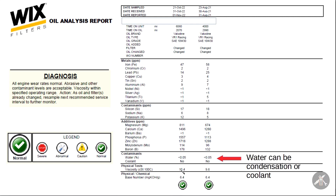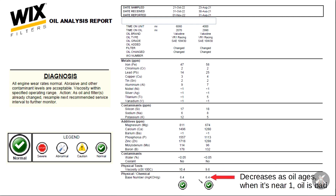Viscosity was good and is good again; shorter miles here show it slightly higher. The total base number is equal between the two samples. I think this oil was supposed to have a total base number around 9 or 10 when new, and as it decreases toward 1 that would be really bad. Based on the additives, viscosity, and base number, I could actually run this oil a lot longer — probably 5,000 miles — and it wouldn't deplete to a problem level.